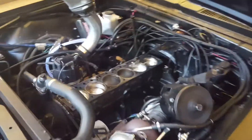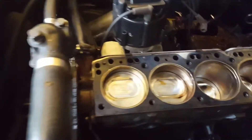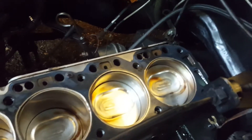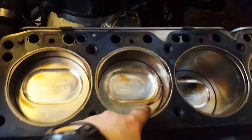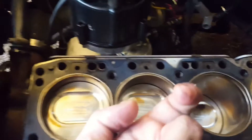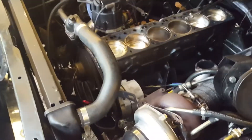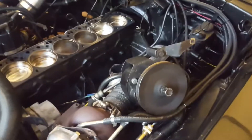About an hour and a half later, we are with the head removed. You can see here, looking in the cylinders, there's definite oil burning going on — not horrible, but some. Obviously need to wipe this out; this is still dirty. For the most part it looks pretty good still, considering it had this much oil burn for this long. I'm not super surprised by the condition. There were some challenges getting it out — I had to take the power steering pump and shove it to the side.